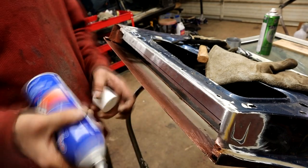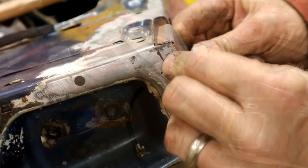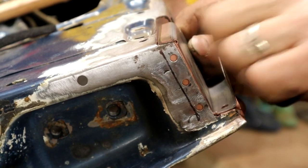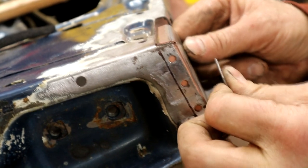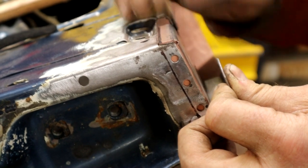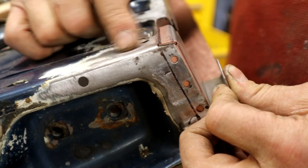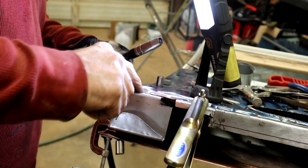I think this video is going to get pretty long, so it's going to have to be broken into a couple at least. So anyway, you can see this is very close to 90 here, but this flares up slightly. So that's just a question of tapping this flange of mine to copy that as close as possible, bearing in mind we're tack welding it on this piece, not this piece. This is the piece that's going to wrap over that, cover that, and go down, you see. So we're concentrating on leveling to this one here, not this one, trying to make sure it's as level as possible.